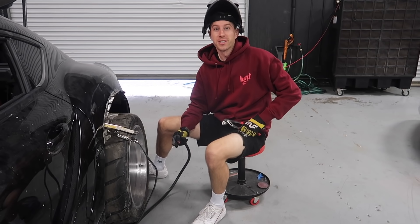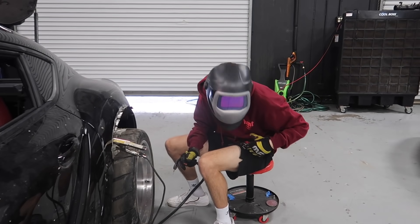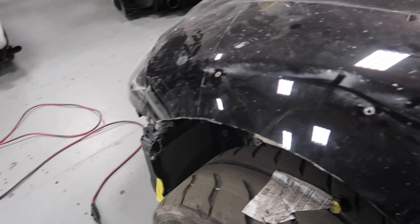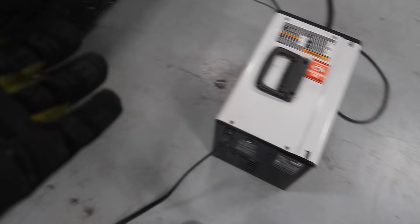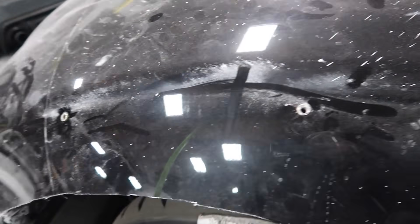While TJ is welding — I just stared at the arc and I'm blind right now. So while TJ is tackling the welding, because I don't know how to use this thing — I only know how to TIG weld and I don't care for it — I am going to clean up all of the edges on the kit, because the kit needs to fit perfectly and this needs to look good underneath. We're also going to tackle the rivnuts because some of them are in a bad position; we'll just drill them out and replace them. It's a really simple job. TJ's got the hard job.